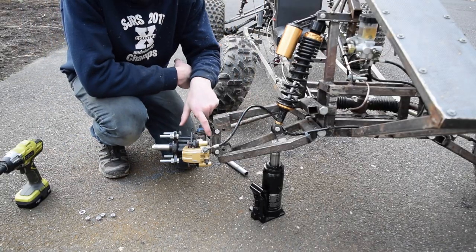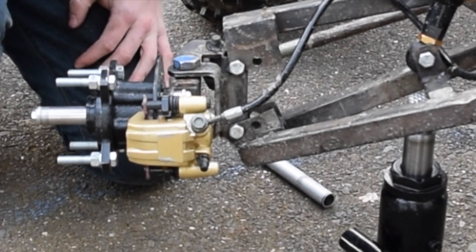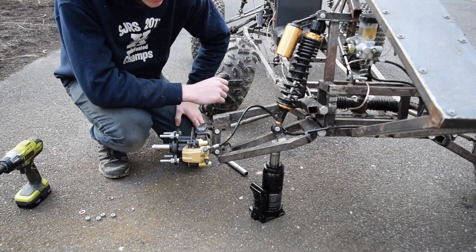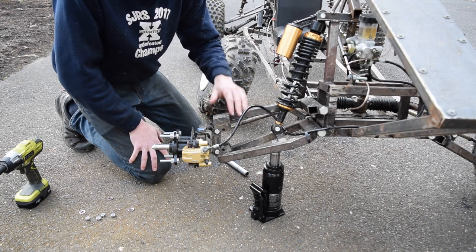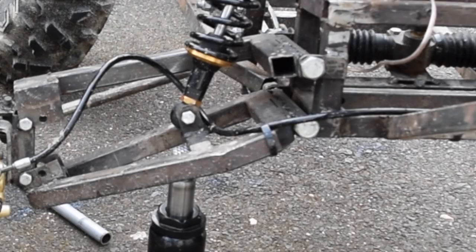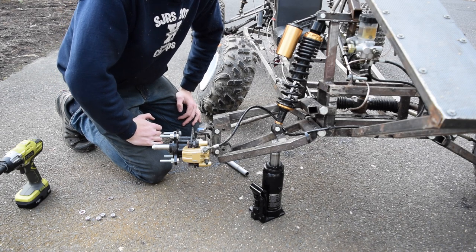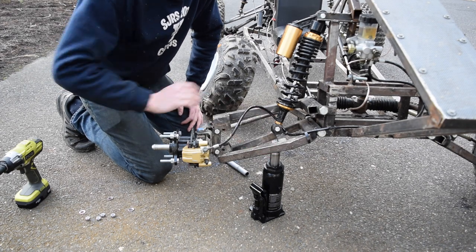Moving farther up, the spindle bracket is welded to a piece of one inch square tubing with two holes drilled in it for the pivot points for the front lower A-arm and upper control arm. The lower A-arm is also made out of one inch square tubing bent and shaped, then welded with two steel plates with holes drilled in them to mount the spindle bracket. Also welded on the bottom A-arm are the shock mounting tabs — just 3/8 inch holes drilled in there. Connecting it all to the center mainframe are two seven or eight inch long 5/8 inch bolts — very large but definitely strong enough. I used 5/8 inch tubing as the pivot point and welded it directly to the A-arm.